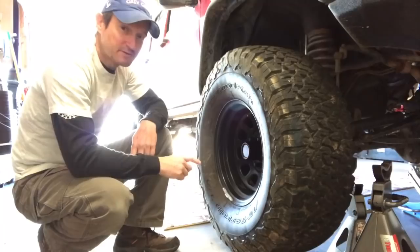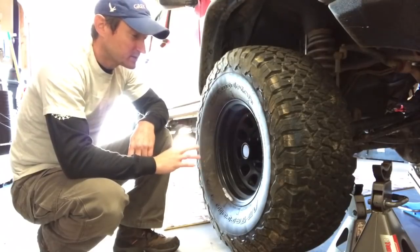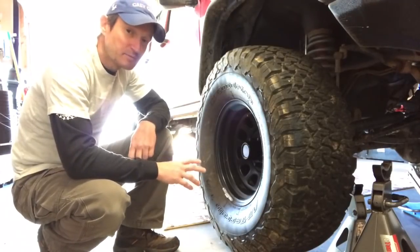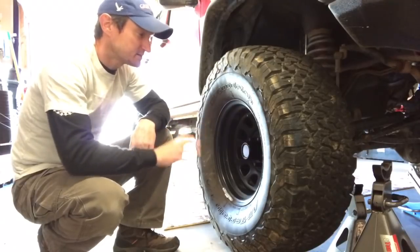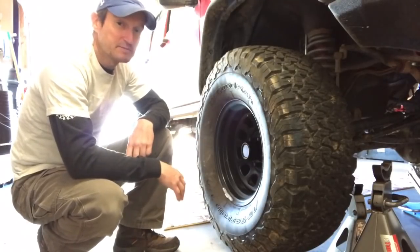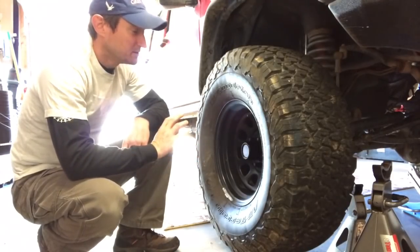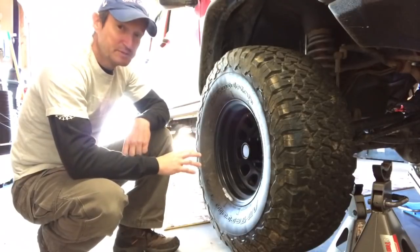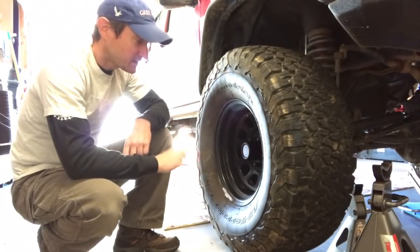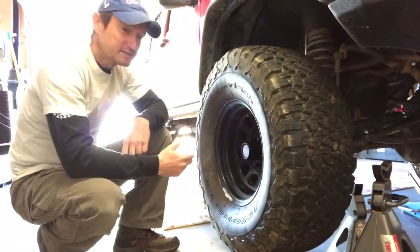If you're going to replace your hub, now is a good time. While you're doing your ball joints, go ahead and look at the option of replacing your hub, your brakes, your calipers if necessary, the caliper boots, your rotor — anything that's in this entire system. In my case my brakes are good, my rotor is good, my hub has been replaced recently, so I only need to replace the upper and lower ball joints. For that reason I'm not going to take off the hub nut, the nut cover, or the cotter pin.